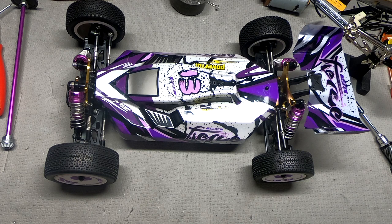At the same time, I would stay with the two-cell batteries, and I would stay with the stock motor or in that range of motor. If you put in a 12.5 like I've done or something even hotter, or you go brushless, first, if you go brushless, you're spending a lot more money. The speed control is more expensive. The motor's more expensive. I don't see that there's a big benefit there. The brush motors run just fine for this type of vehicle. It is only a $100 buggy. It's not a $400 name brand RC car. So putting super high-end stuff into it just doesn't merit it.